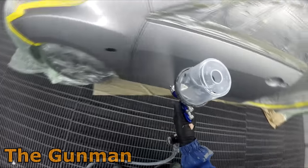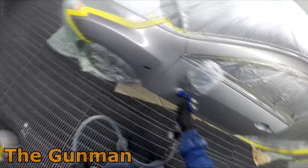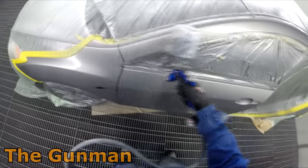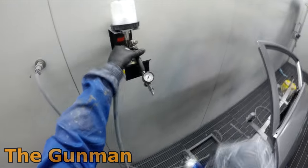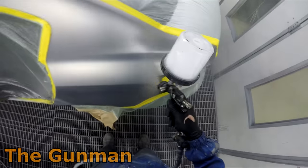I'm no longer putting base coat blender into the color. If you go and mix a color like this, the machine will automatically select a blending option which adds about 20% base coat blender - but that's only put over the edge of the guard. If you mix that into the color, all you're doing is diluting it. I don't recommend it anymore - as long as you get a nice color match it should blend out quite well.